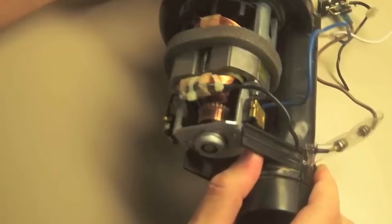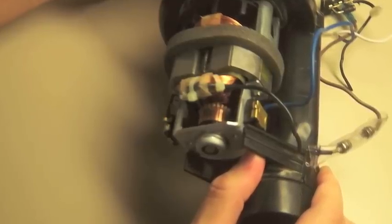This is the motor of the hand vacuum. It controls the fan and the dirt brush. The only thing moving in this motor is the axle, the armature, and the commutator. The commutator is a small cylinder near the bottom, and the armature is the copper windings just above the commutator, in the center of the motor, where it is barely visible. Here you can see all three parts rotating as one.